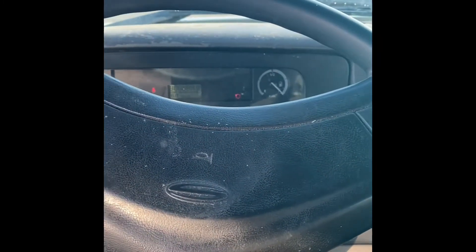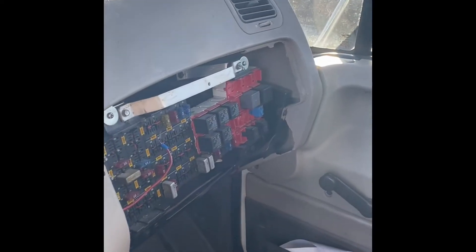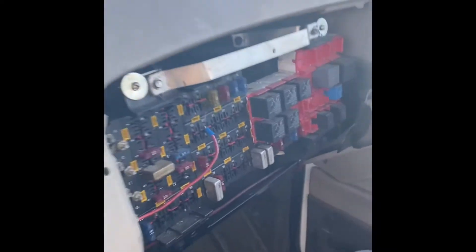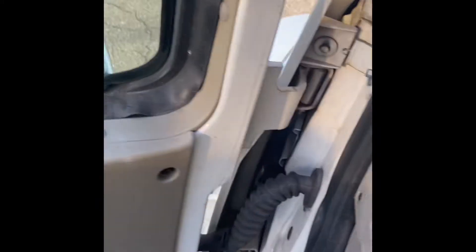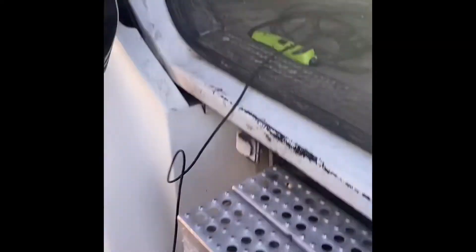Push the clutch while I'm doing this. You hear it clicking, and I hear it over here — sounds like the relay is definitely getting power. So the first thing I'm going to do is go out here and see if that power is getting down to the starter, to know whether it's a starter or a battery or whatever. Let me get it set up and hook this up to the battery.